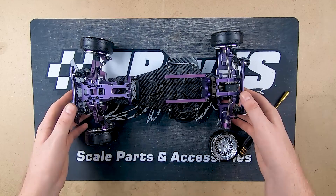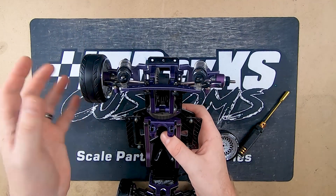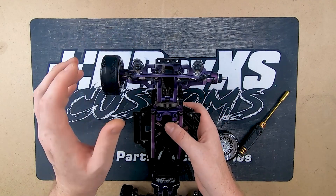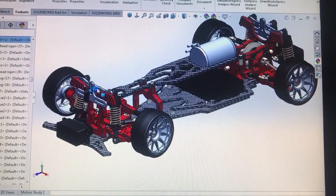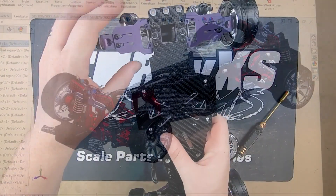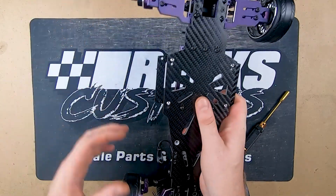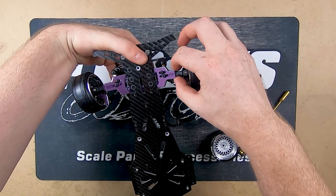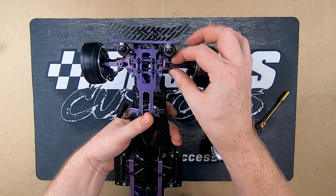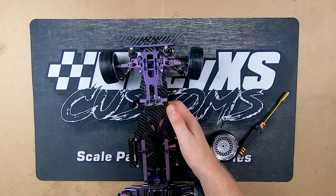You might have also noticed the shocks — they are HSP ones, but they are looking at developing their own shocks based on the HSP shock bodies with their own internals to make them smoother and keep the price down. Obviously in Vietnam they can't just buy everything off the shelf, so they have to manufacture as much as they can. One thing that impressed me is how little play there actually is in the suspension. It is quite tight considering it doesn't have any shims in it at all. The front has virtually no play in it either — they are working to quite a tight tolerance for a small company.